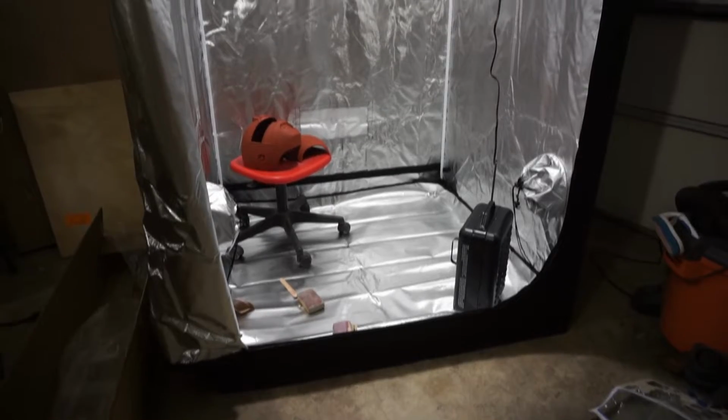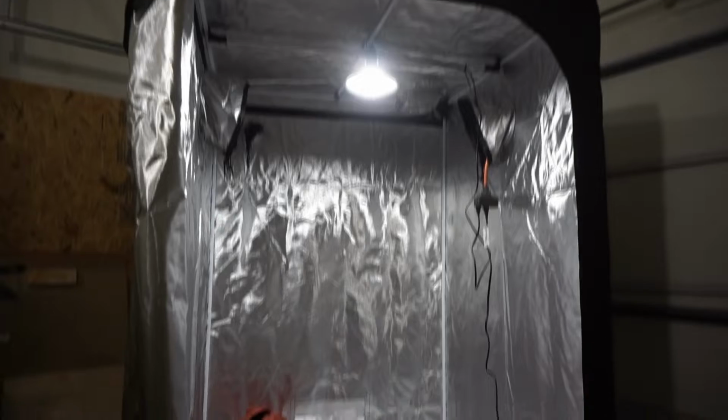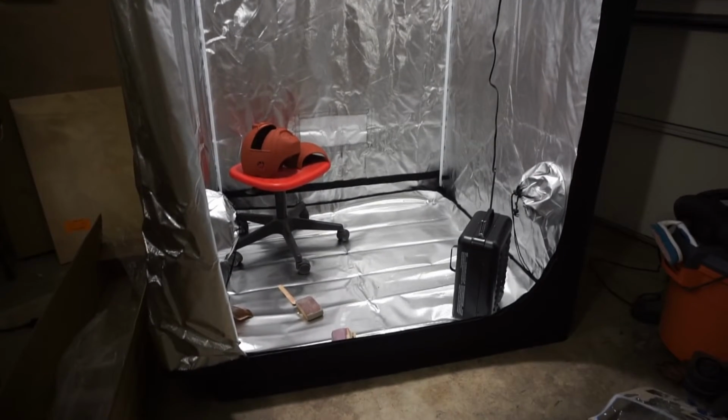After the 220 is done, I actually hit it with another round of that Duplicolor filler primer. And here's the next upgrade to that. So I got rid of that little tarp. I actually ended up buying 2 grow tents. They're pretty big. I bought one that was 4 foot by 4 foot by 6 foot, and one that was 5 foot by 5 foot by 6 foot. And one of them I'm going to sand in, and one of them I will paint in. It's super nice because I can put the space heater in there, turn that on for like 3 minutes, and that whole box is nice and toasty, and then I'm good to go to work on these projects.